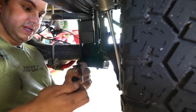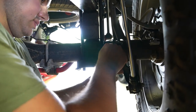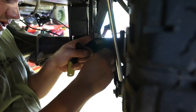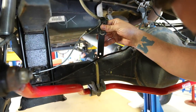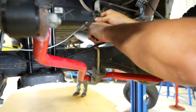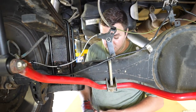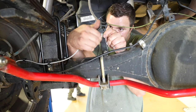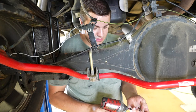One of the final steps on the rear: install the provided brake line bracket just like the front. Take the factory bolt and thread it into the factory nut on the axle, line it up with the factory brake line, and tighten it down. Do this on each side. On the back it's the same concept with a different line — put it through and take your bolt, thread it in. Tighten down all brake lines — make sure when you tighten them they're vertical and not pulling wires one way or another. Factory bolts are 12-millimeter. The provided nut is 7/16-inch. Tighten down vertically.